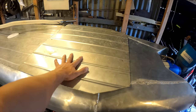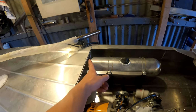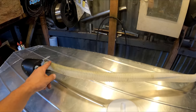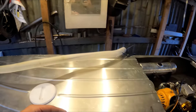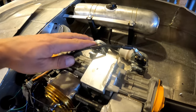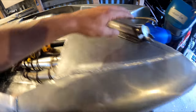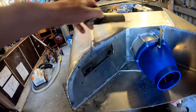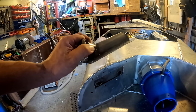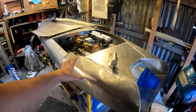Things left to do: fix this lid down, the breather for the fuel tank where a hose goes on there and comes up halfway so this tank can breathe. I might have to bend these little tags on here, get these throttle cables running a little bit better because they're a bit finicky. The exhaust wasn't mounted — that's why it was super loud — so I need to do that. We're getting close to running, guys.